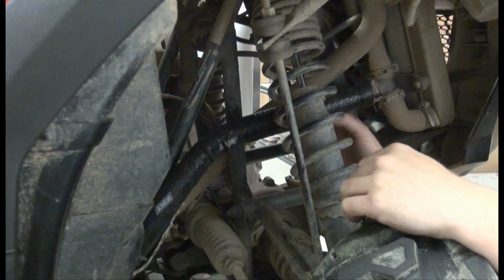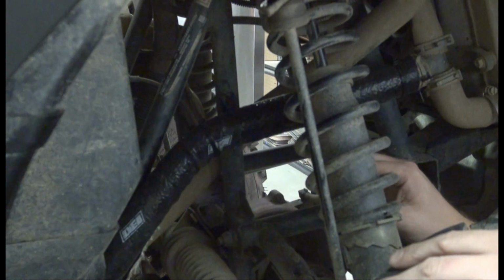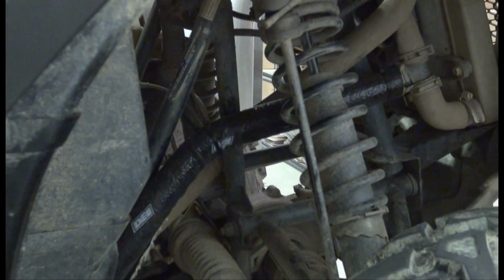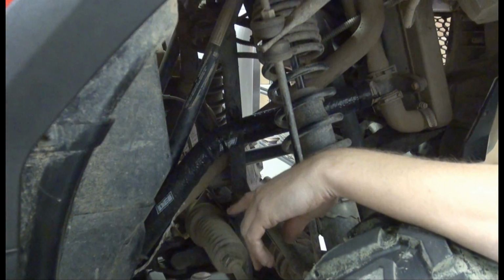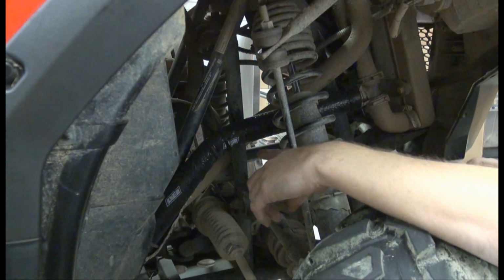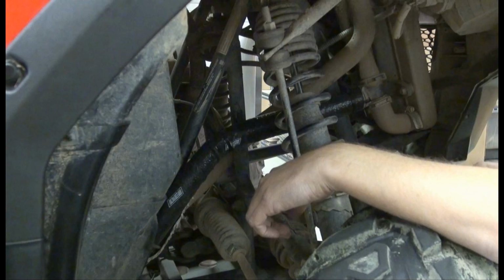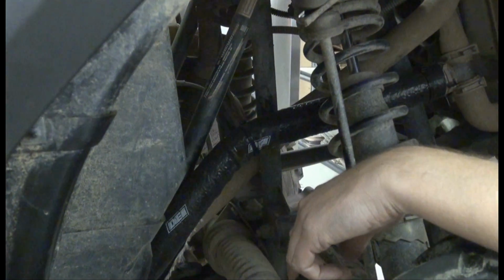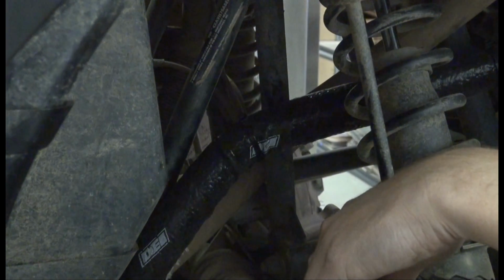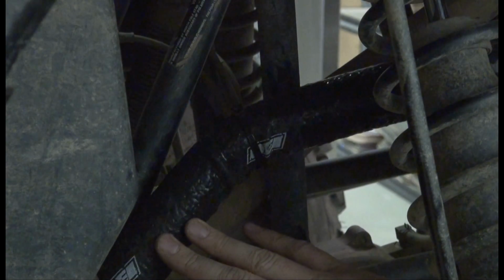In addition to the fire wrap in the back, next to the rear tire there, we noticed that there was a vulnerability up front here, and so we went ahead and used the fire wrap again, covering this radiator hose. Again, as debris and stones come up from the front wheel, especially on a four-wheel drive vehicle, there is a tendency for stones to have a chance to cut this radiator hose. So just as a matter of precaution, we had the vehicle, we went ahead and lined the front here. Great precaution, especially for all the racers out there if you're riding in rugged conditions. Nobody wants to pour coolant all over and not finish a race. So it's one other step that we took. Again, nice outer silicone coating with the braided fiberglass sleeving.